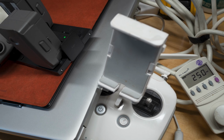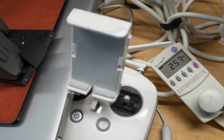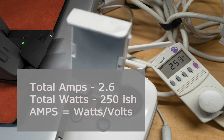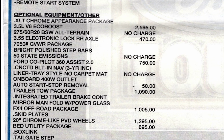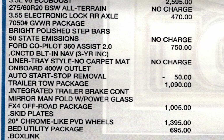That's impressive though. You could power a small mobile office from the 2016 Ford with no problem. But a note of caution: while you may be able to run an inkjet printer on a modified sine wave inverter, a laser printer will not work unless you have a true sine wave. More on that later.